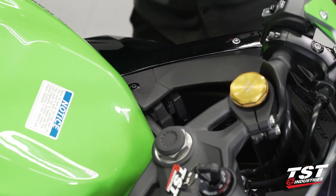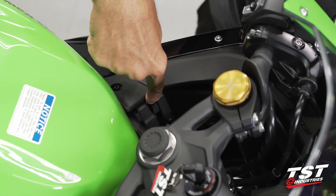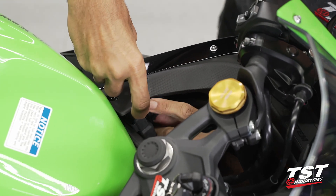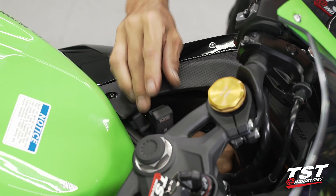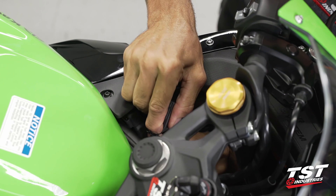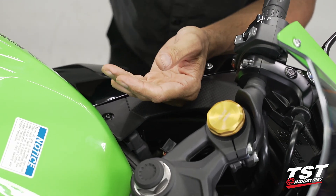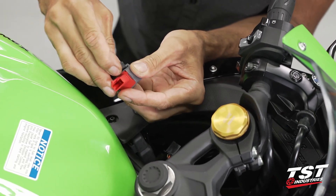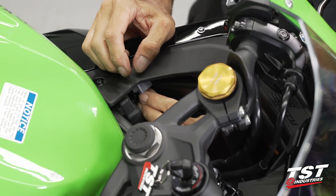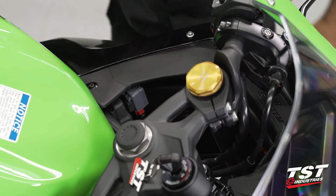Let's get started. Our relay location is right below this plastic shroud — this is our relay, sitting on this steel tab. I get my hand in underneath and just dislodge this guy. I help myself with my right hand by prying up on this plastic, and then we have the relay come off. This is the locking feature for the connector — press this down, withdraw it. Then I will scavenge this rubber keeper. Grab our new Gen 2 relay, get the rubber keeper on, reconnect, and then remount back on the tab.